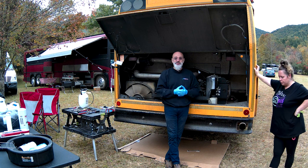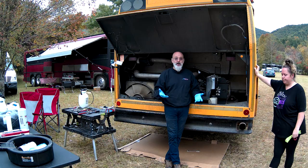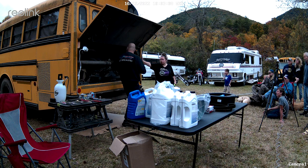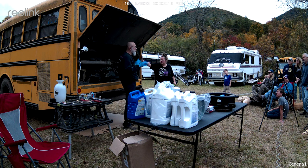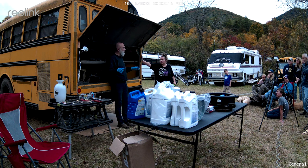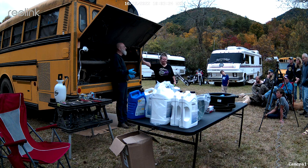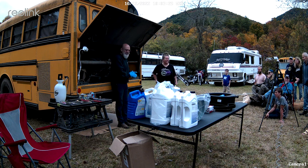But the symptoms that she had were the same symptoms as if we have a clogged fuel filter, or a clogged air filter, or one of these pipes that's blown out. So if you ever get one of these little connectors that goes, you have no power whatsoever because you have no turbo. Some of you have an older bus that has no turbo. Great. Simplifies your life a little bit. You don't have power to start with. You won't notice the loss.